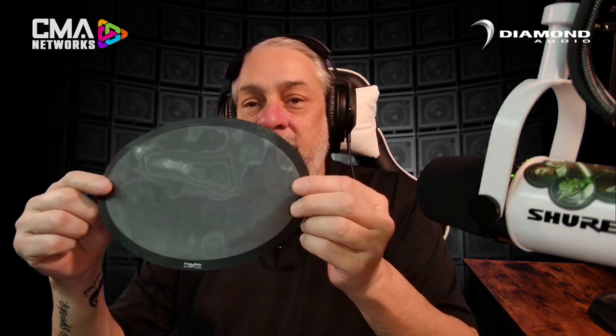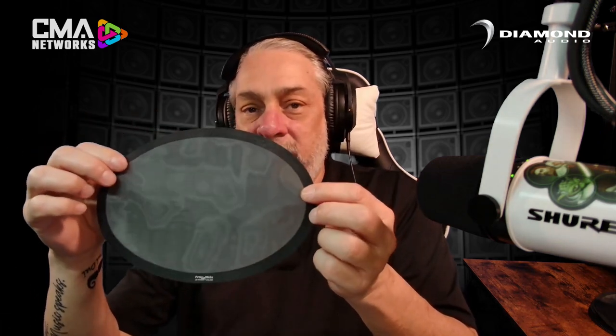They can be attached to any of our speakers. For a 6x9, the great thing is — as we were showing at CMA — you can attach this to the speaker, to the spacer ring for our lid kits, or you can attach it to the lid kit itself. You just invert it and stick it to the underside of the frame of the lid kit, and then your 6x9 bolts to the lid kit underneath it. It already has holes perforated in it for the lid kit. It is 100% acoustically transparent but will not allow water to pass through it. For guys using compression horns or any other speaker that may not be 100% waterproof — on a bike, boat, side-by-side — this is your solution.